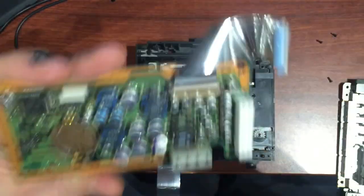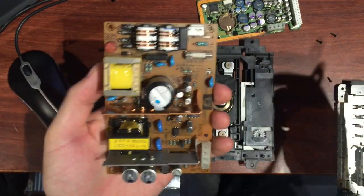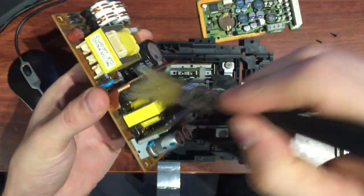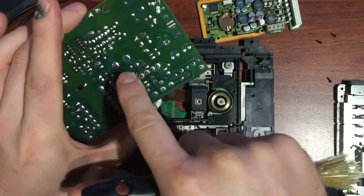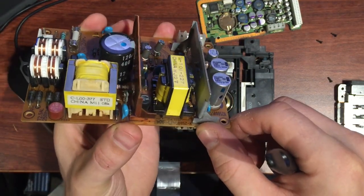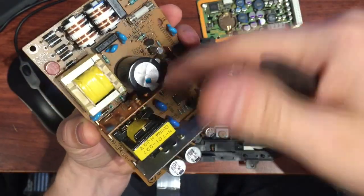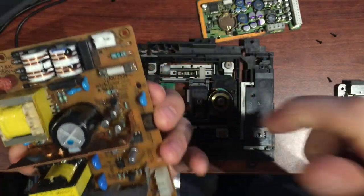You take the opportunity to put a battery in, clean out everything with a brush or compressed air or both. The power supply is a really simple unit — it's quite heavy. Get down next to the voltage regulator and give it a really good dust out. But don't touch the bottom of the capacitor pins — that big cap is probably fairly safe, but if it's freshly unplugged from the wall, it could definitely hold charge. It's a 120 microfarad 400-volt cap — and just by its physical size, it's going to hold a bit of charge. So don't touch the pins.